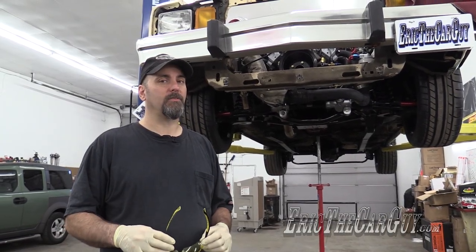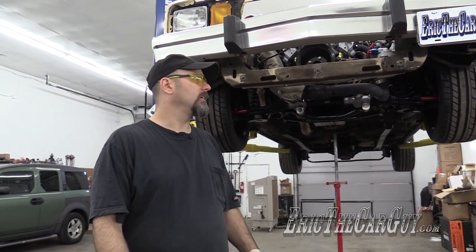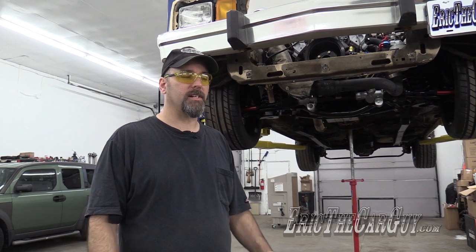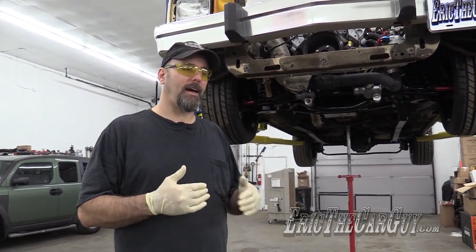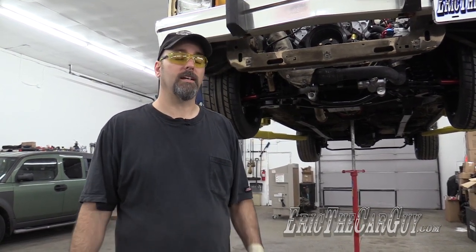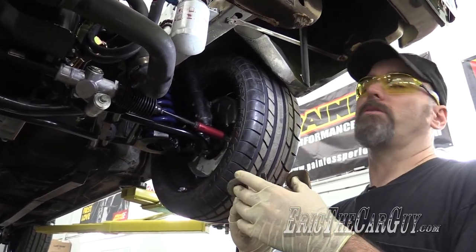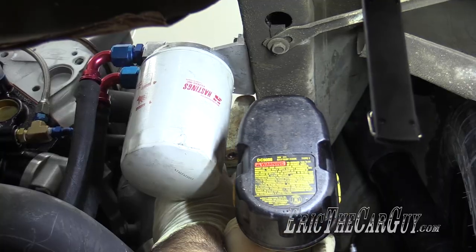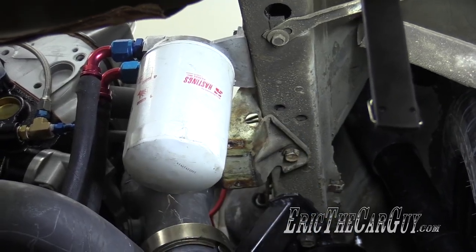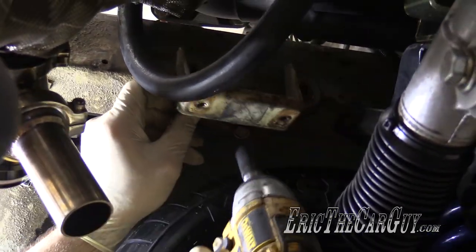Welcome back — Brian and I took a little break yesterday. We reached a certain point with the project and now we're coming back. I stayed a little bit after the camera was off to try to figure a few things out, and I'm going to share those things with you today — starting with the fact that I believe I'm going to be able to use the stabilizer bar. Going to start with remounting the brackets. I don't have to put these other two fasteners in the top — we're just test fitting, remember? I'm really glad that I repaired the threads in this hole, because now I don't have to mess with it.